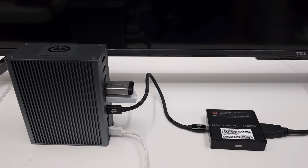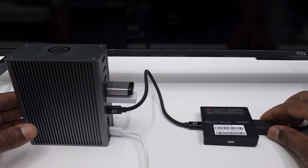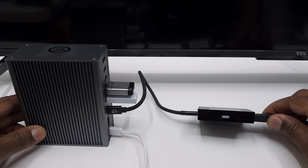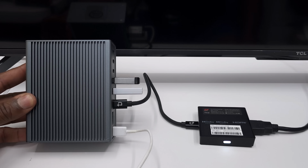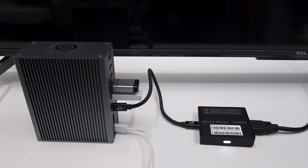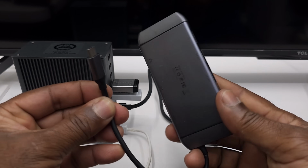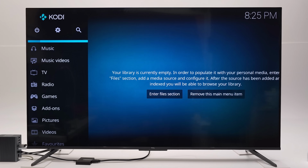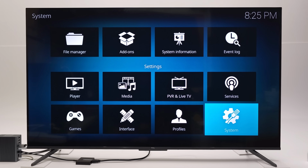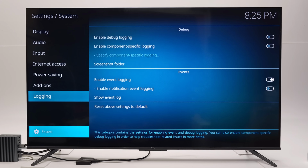Watching 4K HDR and Dolby Vision self-hosted videos I believe is the most challenging. Firstly, to read external storage, you have to connect the TV dongle to a USB Type-C hub. This is the one I'm using, and you can get a link to this one in the description below. The regular USB Type-C hubs like this one do not work. So to play 4K HDR videos, the media player I recommend is the Kodi media player. All other media players have some issue in some way or the other processing a particular audio or video format.